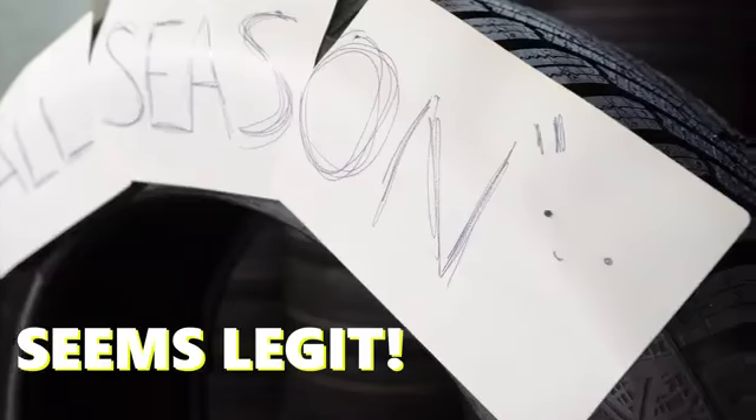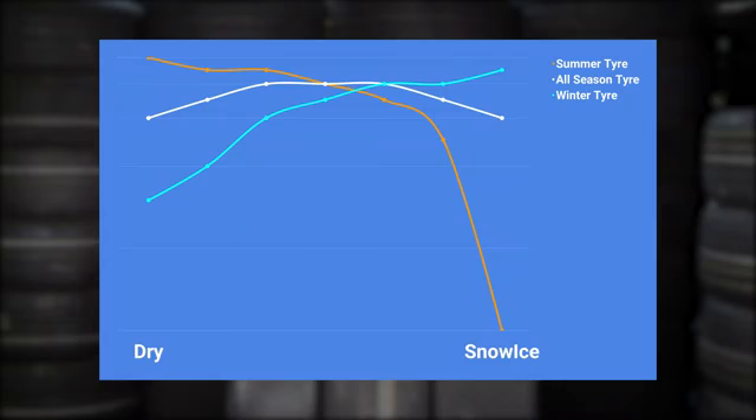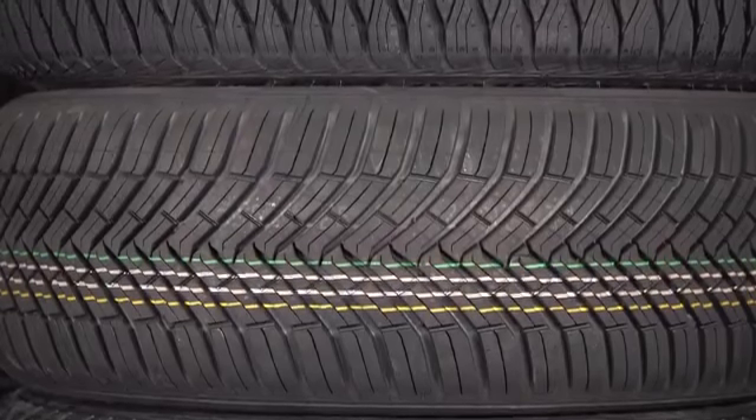You should probably understand the perfect all-season tire just doesn't exist. Sadly, we don't have the technology to make a tire that works excellently in the dry and wet, and really well in snow and ice. Going back a few years, some of the less scrupulous manufacturers simply put an all-season sidewall on a winter tire, so your all-season tire was essentially a winter tire. Fortunately, manufacturers — especially the premium manufacturers — have got a lot better at making a tire that works in most conditions, but still doesn't quite have the peak optimum grip of a summer and winter package. The main compromise of any tire designed to work in snow and ice is, unfortunately, dry grip, which has led me to coin the phrase the dry-snow-ice balance — the balance between the dry performance and the snow performance the manufacturer has to make.